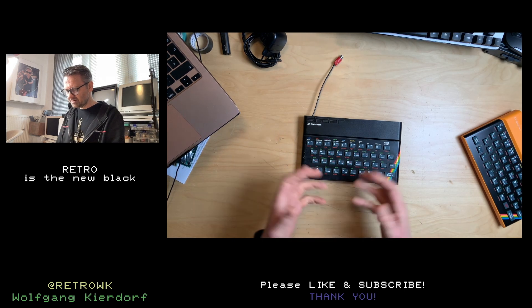At minimum I got a working keyboard and case. Now let's check if we can get the actual spectrum running. I want to make sure the composite mod is as good as it gets - this external cable is unnecessary because you can use the internal connector. I'll remove this cable and put in a 100 microfarad 16 volt capacitor, putting the negative lead through the hole and connecting it to the center of the connector, with the positive going into the first hole from the side.